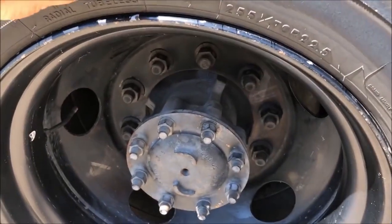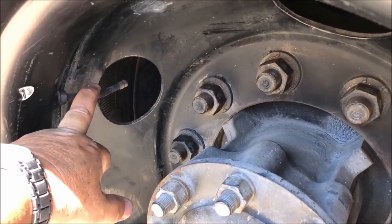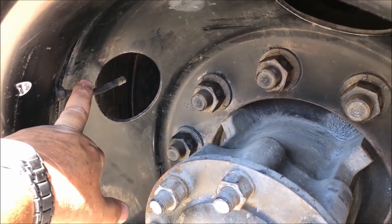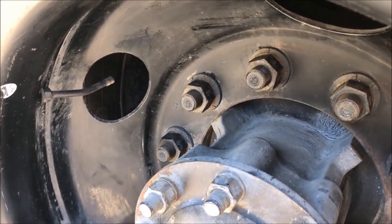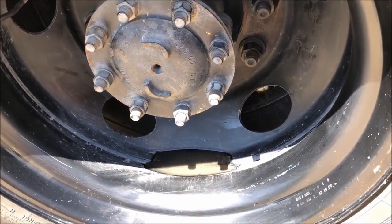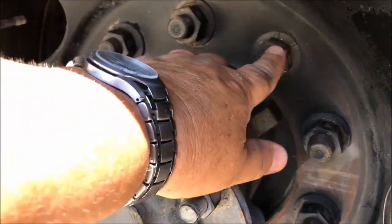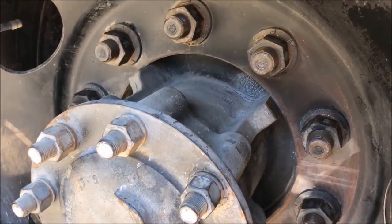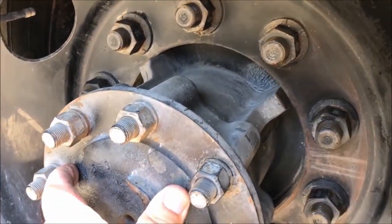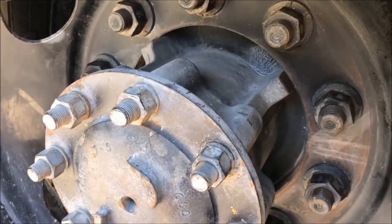The condition of the tire is good. Here is your valve stem — you would check that with a commercial air gauge. It is straight, not bent or broken. The rim is in good condition, not broken, not cracked, no illegal welds. All your lug nuts are in good condition, securely mounted, no rust. Your hub seal is securely mounted with nuts and bolts, and I see no oil.